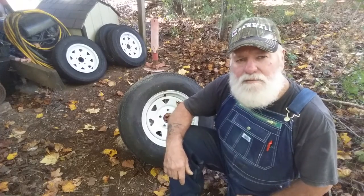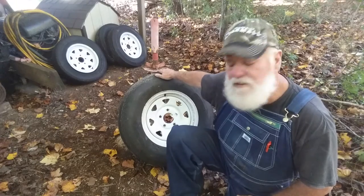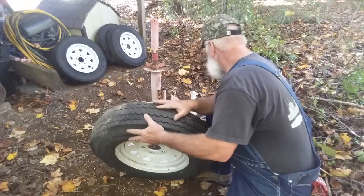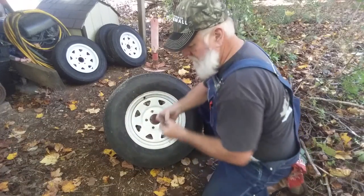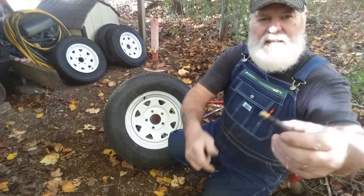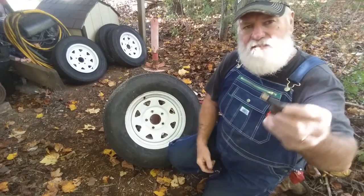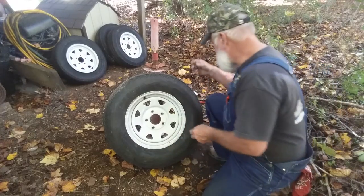What I have here is a Harbor Freight tool that breaks down the tires and you use it to replace the stems. I had a problem with some valve stems. The cores came out — here's what you can end up with going down the road. The center of it just blew out. I guess the sealer around the stem just gave up, but anyway, I had two of them right there.